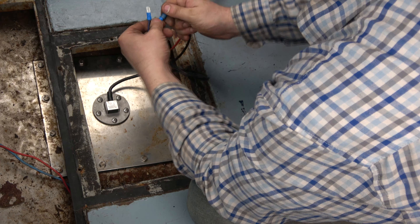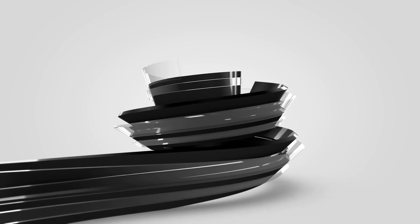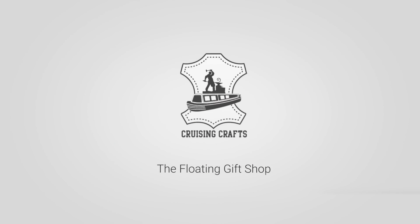It should be a simple fix. We've had a little problem because things are going too well. There's a backing plate that the screws go through, and the holes are too big — there must be a backing plate. As we unscrewed the old sender to lift it out, the backing plate must have fallen off — that's inside the tank. So we just need to undo these bolts to take this access panel off and then we can sort that. In fairness, that will give us a good look inside the water tank as well, so I can see what kind of condition it's in. It's a little bit of an inconvenience, but at least I'll see what the state of the water tank is inside.